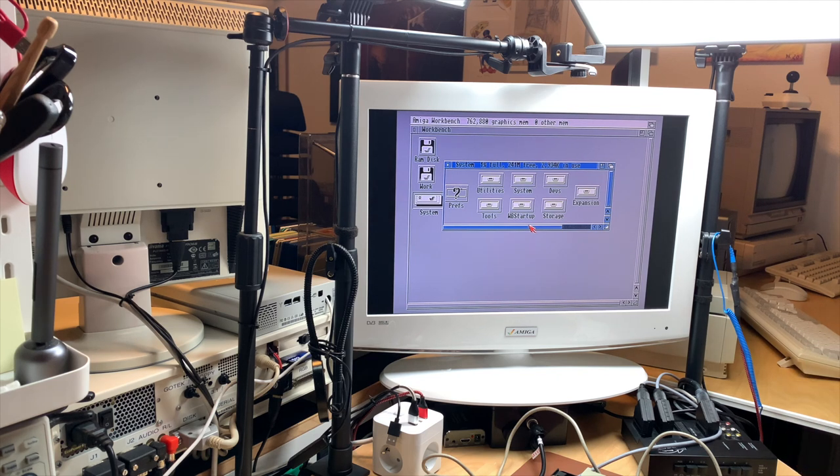So now let's clean all this up. Make a permanent connection for the power and put it all back together. And then we have an A500 with an internal hard drive, just like the A600 or the 1200. So this would have been my dream setup as a kid, having an internal hard disk. And you could also put the CF card somewhere over there where there are those slots. Or you could put it in the RAM expansion slot down here, so then you can just change it and put stuff on using WinUAE and stuff like that.